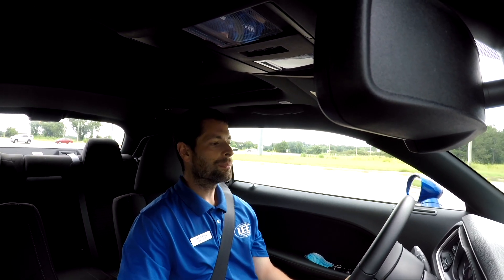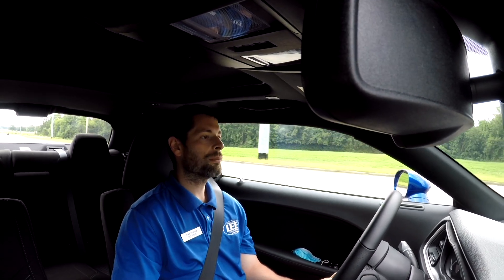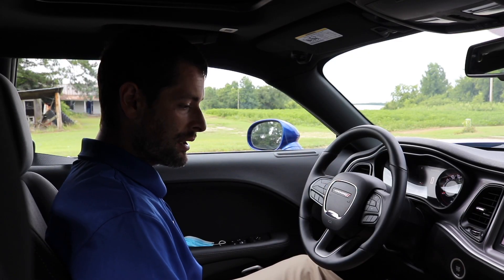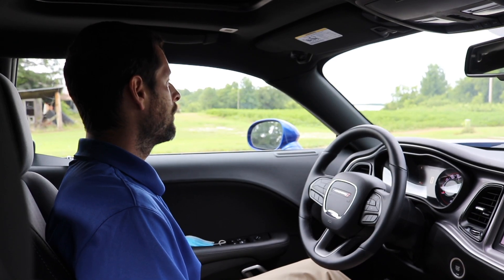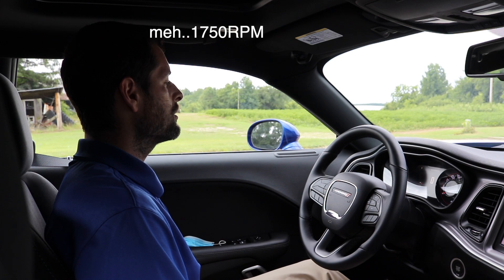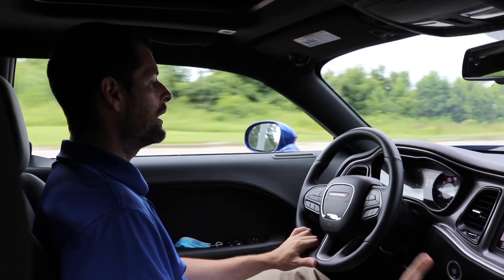So I'm going to pop it into Sport and see the difference. When I put it into Sport — in the GT it was much more touchy. Already I can tell it's shifting way higher — it went all the way up to 3,500 RPM before it switched gears just going around that corner without mashing the gas. Taking my foot off the gas, it doesn't feel like it does a whole lot of gear braking like the GT did in the Charger. Alright, so let's do the zero-to-60 test — it doesn't have launch control, it's just regular. A little bit of wheel spin — 60.